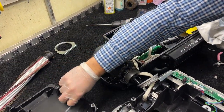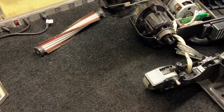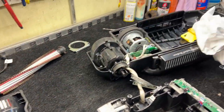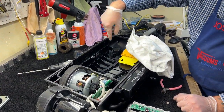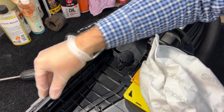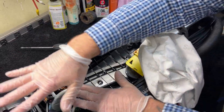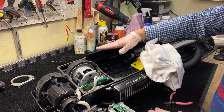I'm going to flip this over and grab all my screws before they disappear — four screws total. I just remembered this is a newer model R40, so I didn't actually have to take this screw off. On older model R40 Tandem Airs, the filter holder was on top of the motor housing so if you took the motor cover off you had to take the filter cover off. On the newer ones they modified that to make it a little bit easier.